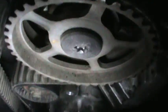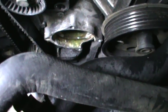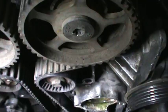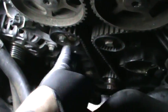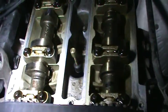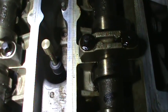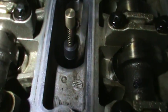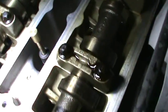I'm just going to go in there, and that'll probably be for tomorrow — I'll be fooling around with that tomorrow. I'm done for today. That's where all that stuff came from, and this is a 6 millimeter hex. Anyway, that's a way to set TDC using a tool like that. It's just a TDC tool — you can go on Amazon, look up a top dead center tool, and it should come up. It's probably less than 20 bucks.